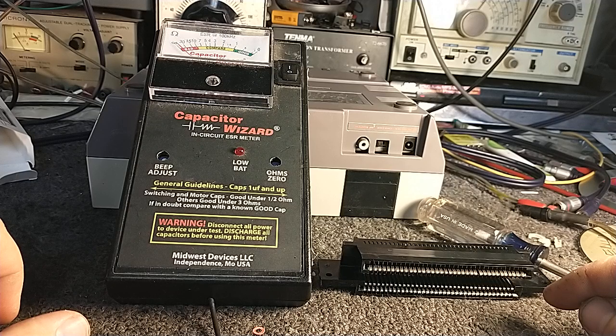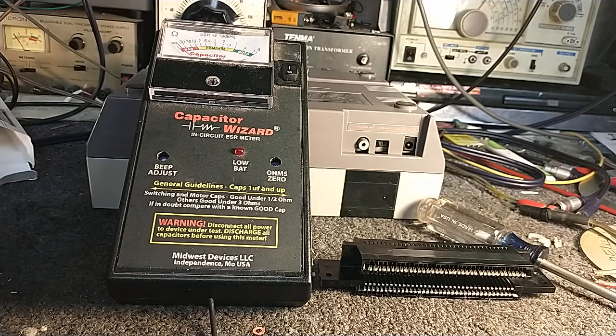Another very crucial point: remember the old cleaning cartridges everyone used to buy in stores — the Dust Tendo, the big neon yellow cartridge with the handle that you'd ram in and work back and forth after putting a couple of drops of cleaner or alcohol on it? That actually accelerates the wear process, because inside the Dust Tendo is a textured plastic sleeve which fits inside the pin connector and you're literally abrading the contact material. It would work for a little while and then screw up again — you are actually killing your connector by doing this.